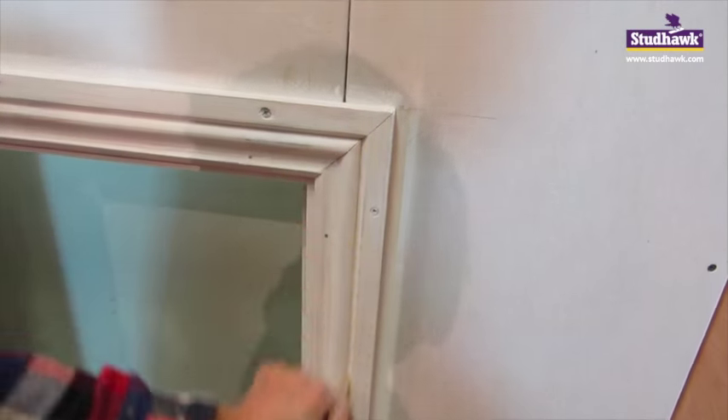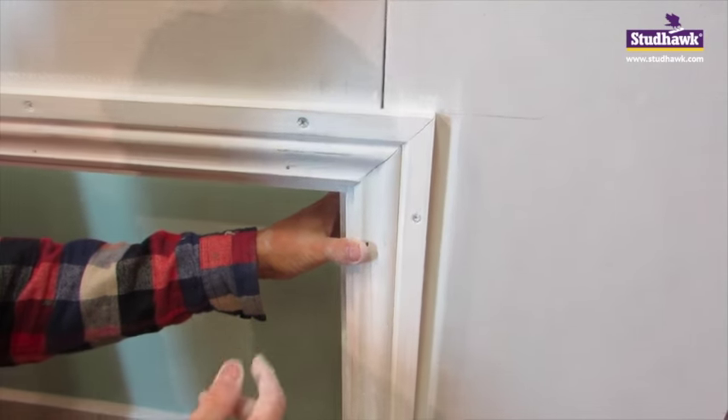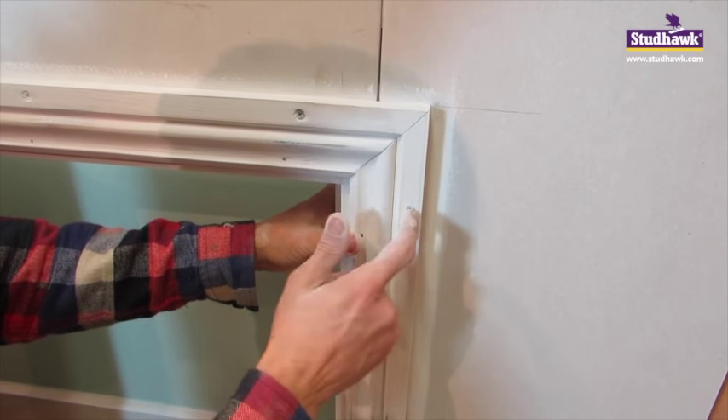Now we need to get rid of the block, curve our paper, and then go into here. Our fingers — our fingers and our thumbs — rubbing these faces into our hollows. We need to curve our paper inside the moulds. Rub them up — they're going to come up beautiful if you do this level of rubbing down between every coat. Next thing we're going to do: give it a bit of a hoover off, and then do a two-pack filler.